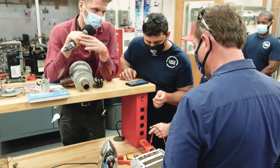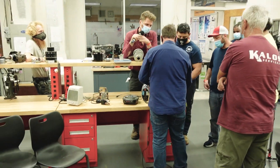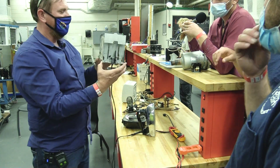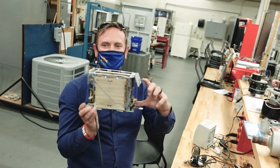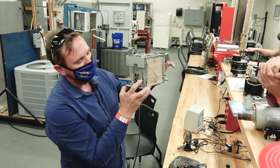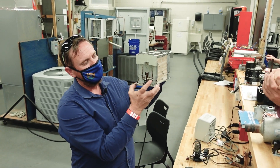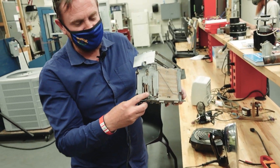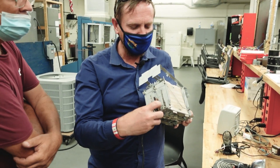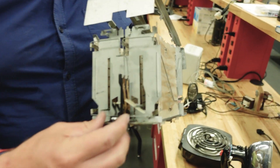862.5 watts of electrical power. This is nothing more than an energy conversion device. But here's what's really cool about this toaster — there's a lot of HVAC parts. Let's unplug it so I can explain it. So here we have our contactor. When we press this lever down on this side, it moves a lever on the other side, and this lever moves these little plastic terminals. When I push this down, notice how this plastic terminal is going to be moving. See how it pushed this down and these terminals now close — they touch. There's two different terminals. What would you call that? A switch. It is a switch. 100% a switch.